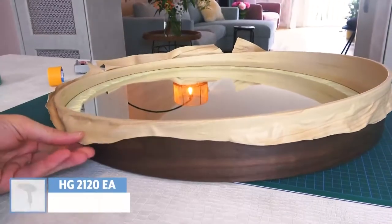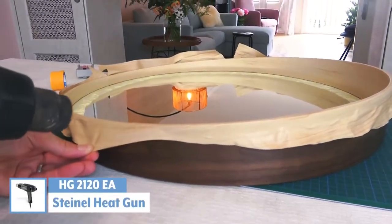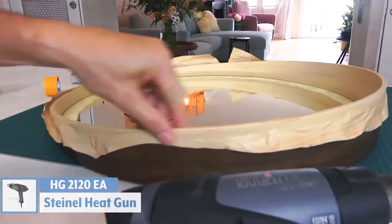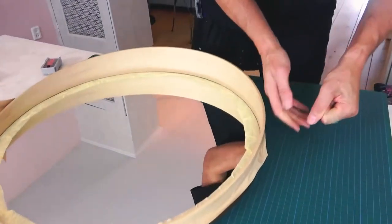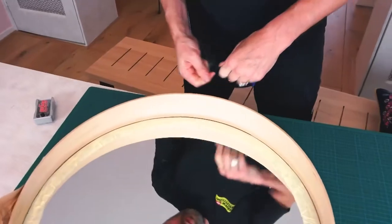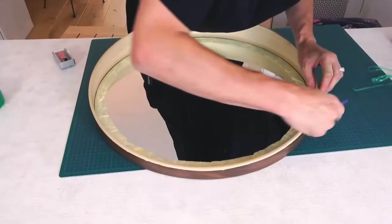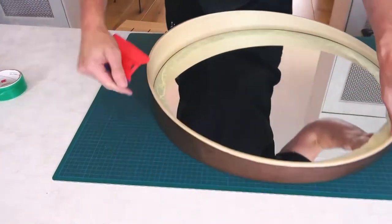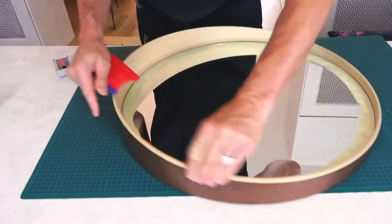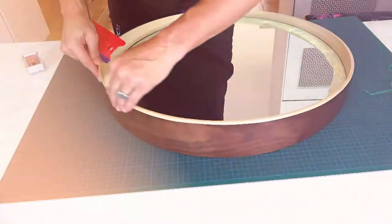Once the film is on the top edge, heat it again and work in increments, forming the film roughly 1 cm towards the other side. Once everything is sealed in place, it's time to release the 3M knifeless tape — be sure to pull perpendicular. Once the excess film has been removed, always come back in with the hard side of the squeegee to make sure the edge of the film is 100% on the surface. Now we're ready for the outside piece.